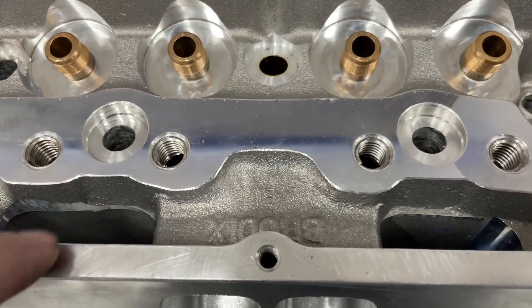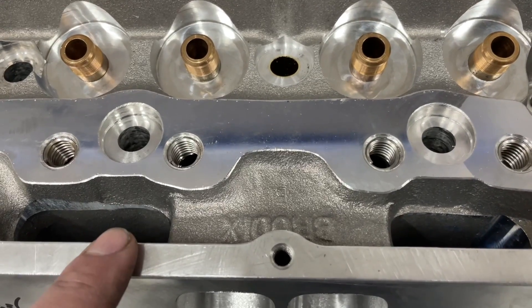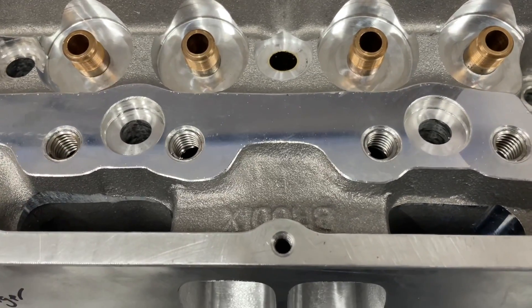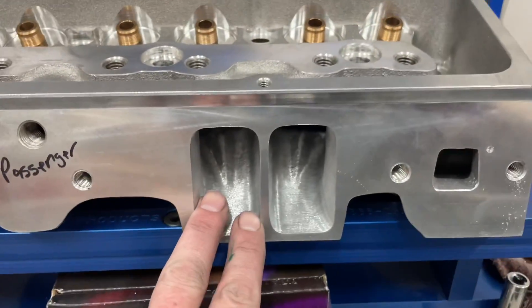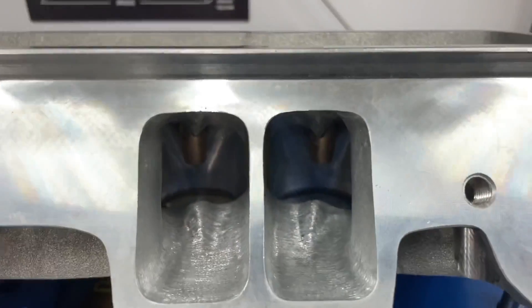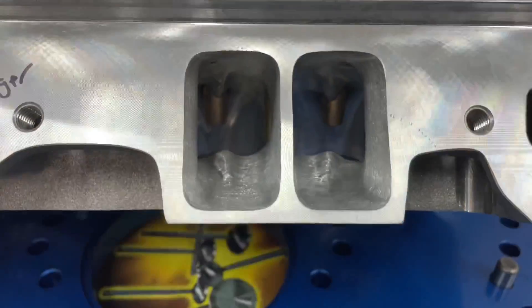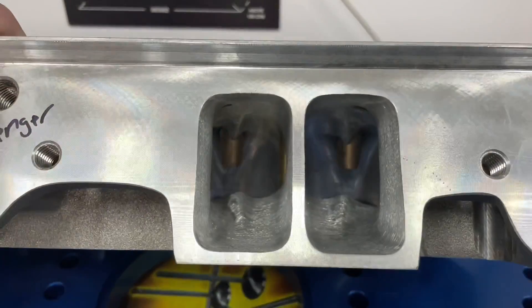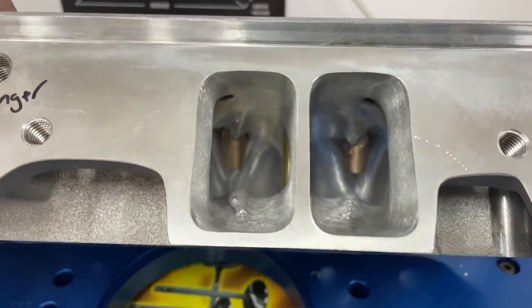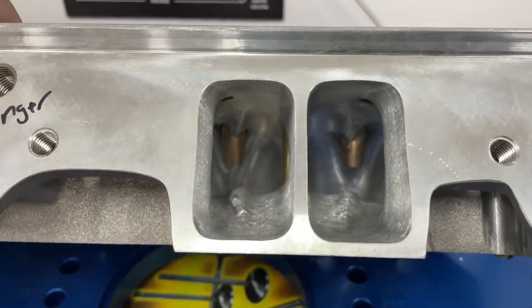You can do a 550 and then you can run an on-center lifter. But if you do a 450, you have to have a 180 offset lifter. 550 — no offset on lifter. Because of that, it makes the push rod pinch itself bigger. This is the wing that I'm talking about — that's why it says W. I've started doing these, I don't know, maybe a year or a few years now. It's one of those things I've done on some heads but not on others.